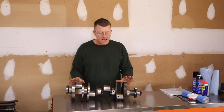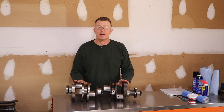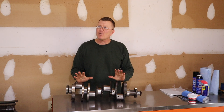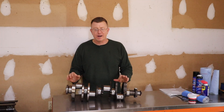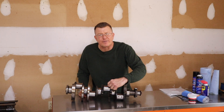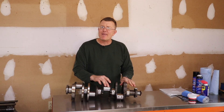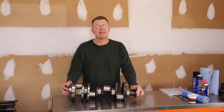After I disassembled the engine, I inspected the crankshaft. I mic'd the journals, and the journals are all within spec. If they're not within spec, you really need to take it to the machine shop to have it ground undersized. I also inspected the journals for gouges and scratches — they only have a few light scratches, no gouges. Gouges mean you're taking it to the machine shop. When I say a light scratch, I can feel a little bit of roughness if I go over the journal with a fingernail, but nothing is catching. If you catch something with your fingernail, you may be at the point where you need to take it to the machine shop.